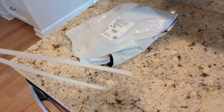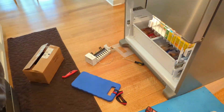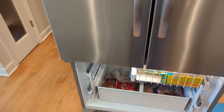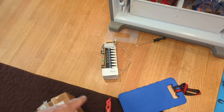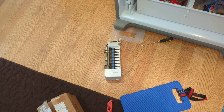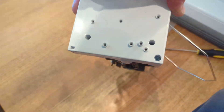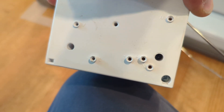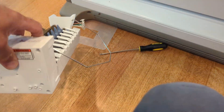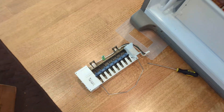Feed the lines through and connect them, then you get the water pressure restored and your ice maker is spinning around — you should be getting ice cubes. So there are a few things that could be wrong with ice makers. The basic tests: first test the water pressure, then test the ice maker itself to decide where your problem is for no ice. If you have questions, leave them in the comments — thanks a lot.